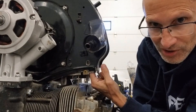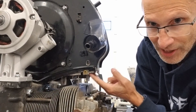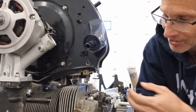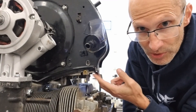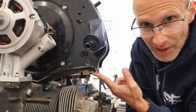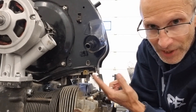In later models in Mexico they eliminated this front part, which I think is actually quite smart — that's just adding somewhat of a restriction of the air right here at the cylinder head so it's really not needed. That was just there to make a piece that stays together. I'm going to be eliminating those, so it won't be exactly the same as these — I'll eliminate that front part in my next iteration of development for this product.